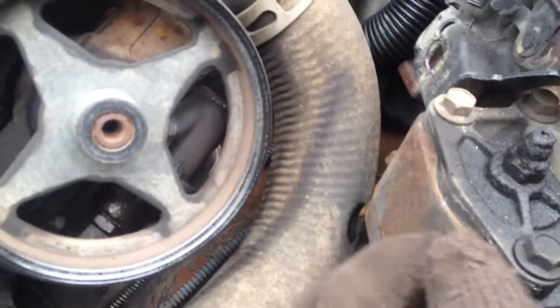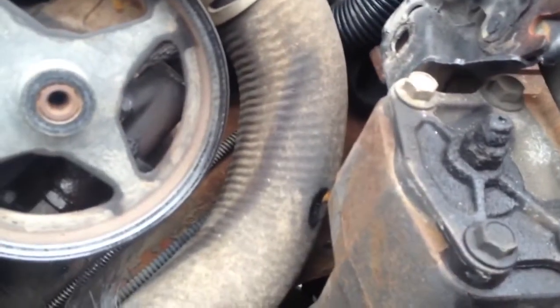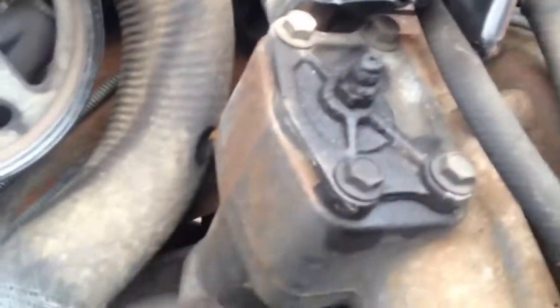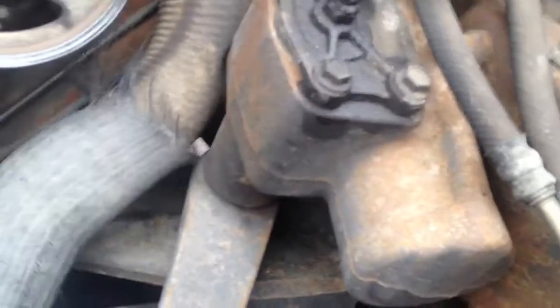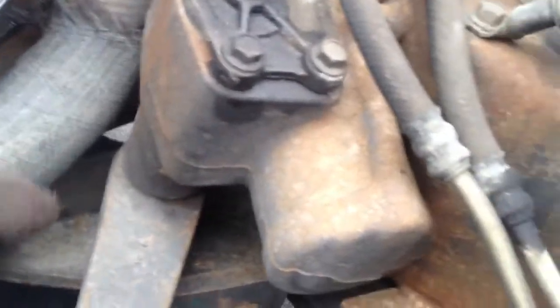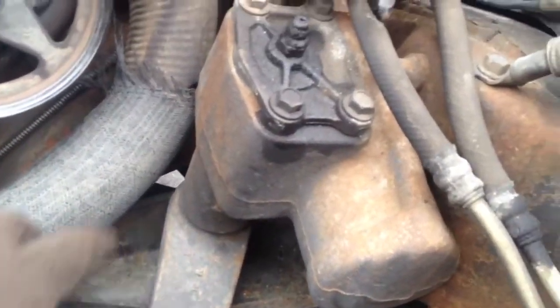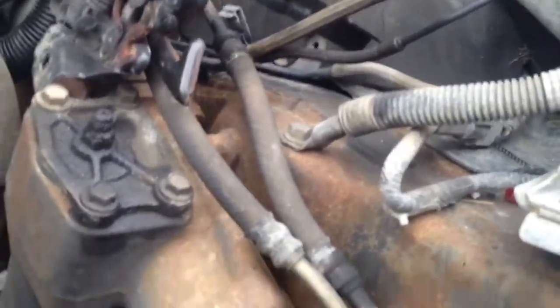Looking at this, this is your power steering pump. Your lower radiator hose is rubbing up against — I'm drawing a blank right now — you have the gearbox here. That's almost rubbed all the way through; you can see the actual fabric support lining coming through. So when you get this, make sure that this braided portion is actually pushed all the way up to where it's supposed to be to cover that and prevent it — they tend to slide down. Look at buying another wrap or something, but when you go through yours, verify that when you reinstall this it's pushed up. I've got to replace this hose simply because it's worn all the way through from just rubbing up against that from vibrations.